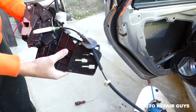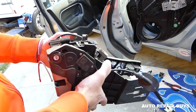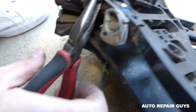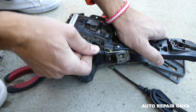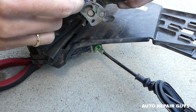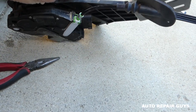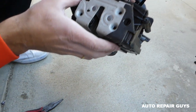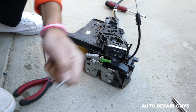This is the door lock actuator — the whole thing with the door lock mechanism, door handle mechanism, and the actuator as well. You have two teeth here, so with long pliers you need to squish them in, then pull it out. The cable will go through here and you'll be able to pull it out. Now we have only two more screws to go.